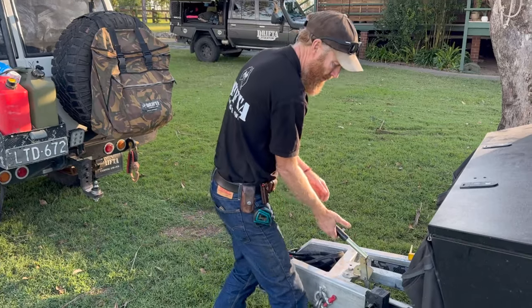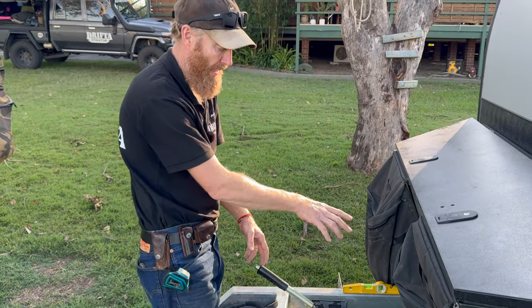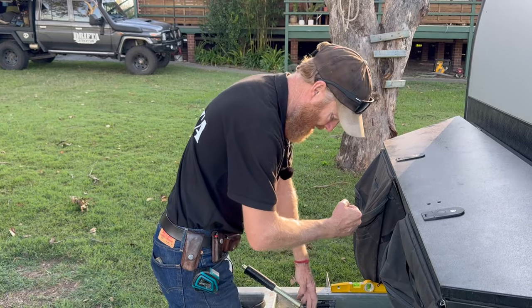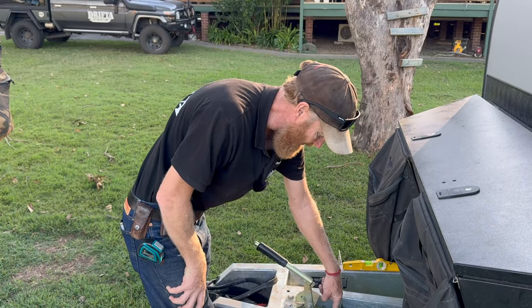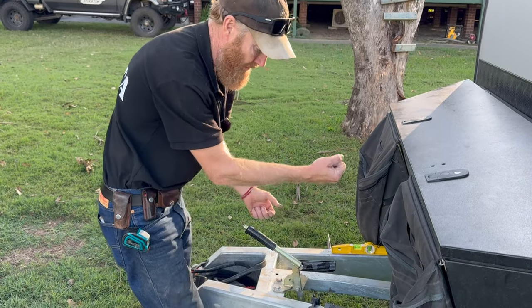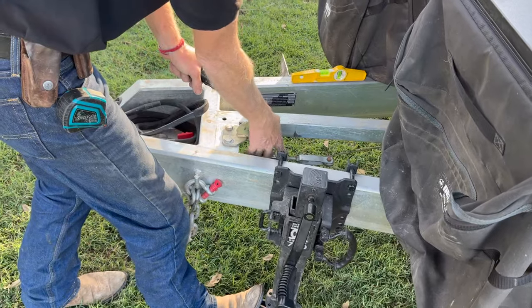The handbrake is very important to be about the center. If it's too loose or the cable stretches, you know, you've got it too far back, it needs adjusting. You can adjust these handbrakes up in this area here, okay? That can be adjusted manually if you've got too much slack. So if you're going to pull the handbrake all the way up here, let it off and adjust in this area here.